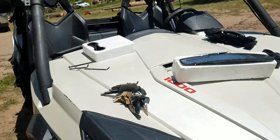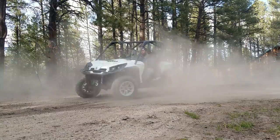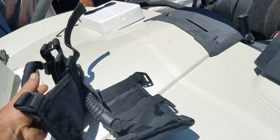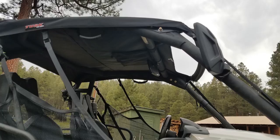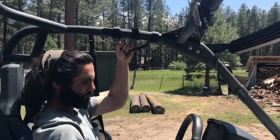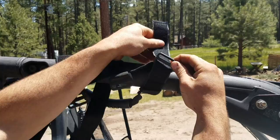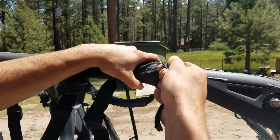BRP does a pretty good job providing passengers with good grab handles, but there's not much for the driver to grab onto other than the steering wheel. So I figured we'd throw on a couple extra grab handles. They come in a pack of four on Amazon for 20 bucks — that's $5 each. These grab handles are pretty convenient since they can easily be installed anywhere on any size roll cage without any tools. To install, go in through the bottom, come back around out through the top, and then ratchet them on down. I do like to trim the excess Velcro strap with some scissors for a cleaner fit.